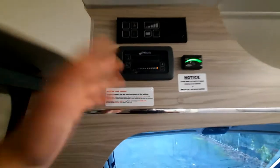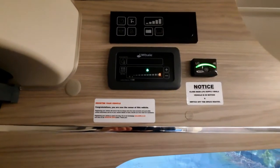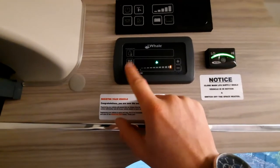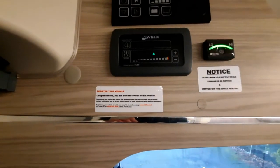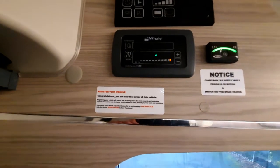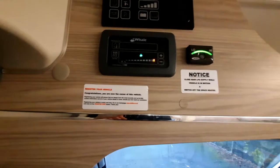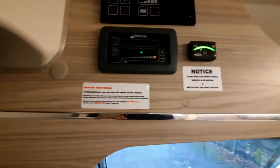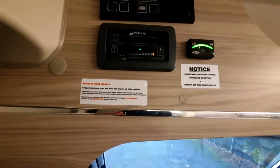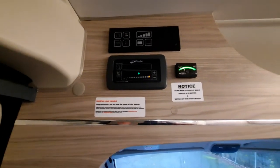Next is heating on the inside of the vehicle — the space heater. Click that and, because we're not hooked up, it's only giving the option of gas, though you can flip to electric when hooked up. If running off gas, you can change your temperatures — gas gets the vehicle up to temperature very quickly as it uses the equivalent of 6 kilowatt electric. When on electric, it's running off only 2 kilowatts due to the power supply allocated to the vehicle, so you may want to have it on full to help it get up to temperature initially.